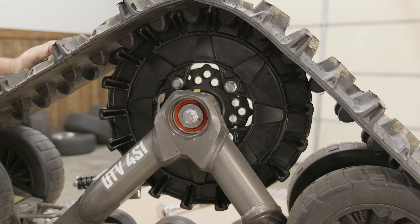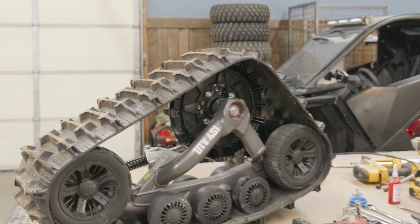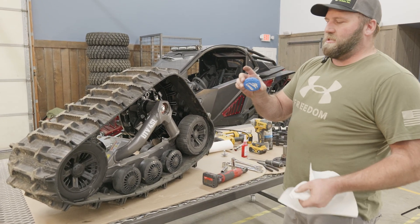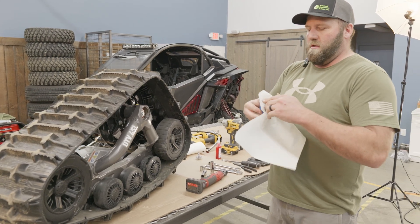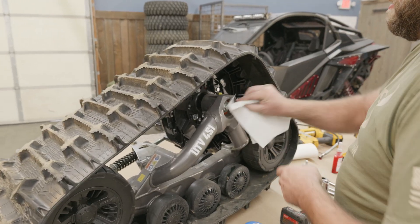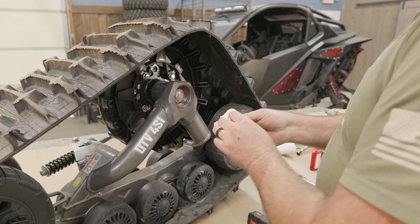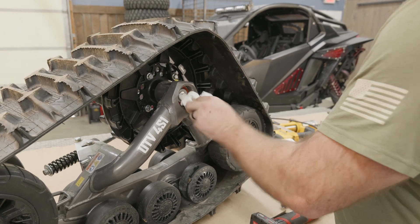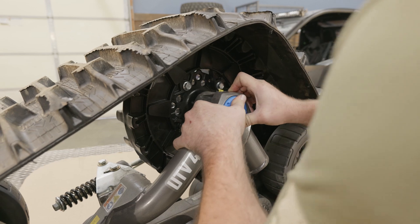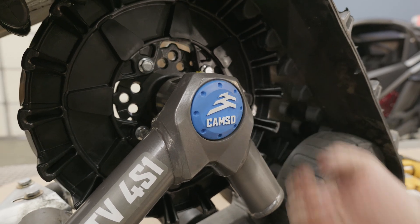At 90 foot-pounds, just like that. A lot of people lose these blue dust caps — with the gasket they don't seal well and always push out on one side. What I do is dry them up real good and clean this super well, because a lot of these will have oil from assembly — that's not a bad thing, they just overfill them. Now that I have this cleaned up I push it in and then rotate it in, and that walks the seal. You can see the dust cover is seated perfectly and not kicked out.